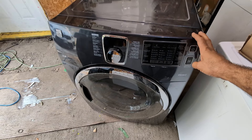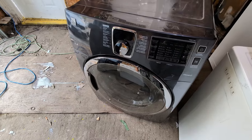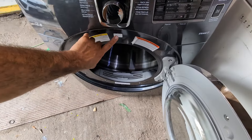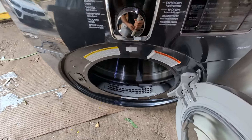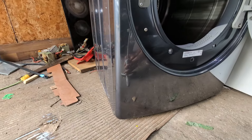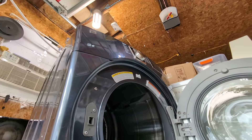That humming noise tells me that the motor is seized, or maybe something is in the blower motor. In order to diagnose it, the first thing you can do is hold the switch, turn on the dryer, and then give it a little bit of a spin with your hand. That will confirm if the motor is bad or if there is something stuck in there.